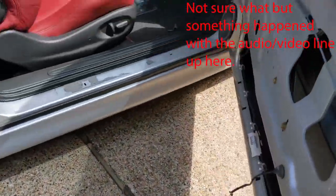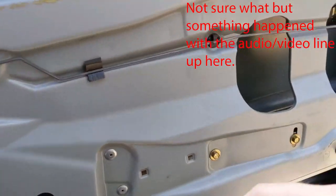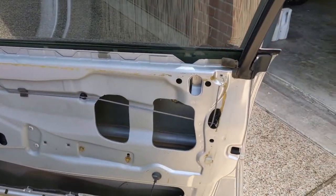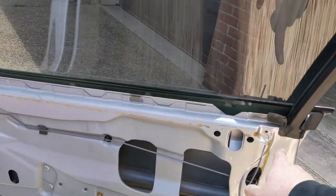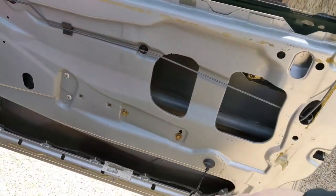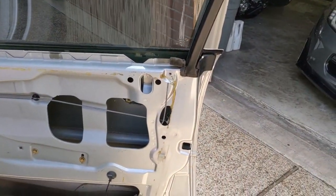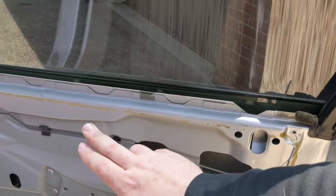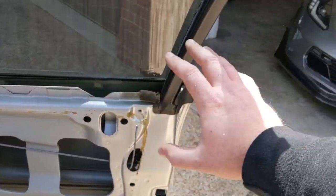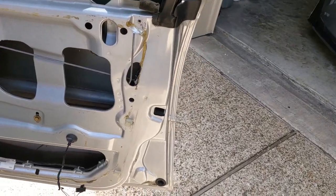Now, if someone has taken this out of your car or this is torn up beyond all repair and you can't do this, you have another option, all right? You can either have someone hold up the plastic to the door, and you can cut it. Let me back up so y'all can see. You can have someone hold it up there and you can cut it the way you want it. Or you can go ahead and run all the sealant that you need around the outline and then just take a big sheet and just stick it on there. Do the top first, pull it down to the bottom, and then any excess that's out here, just cut it. And it's that simple. So those are your two ways of doing this.